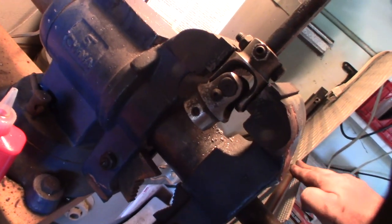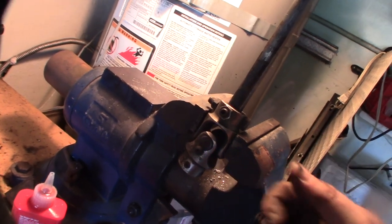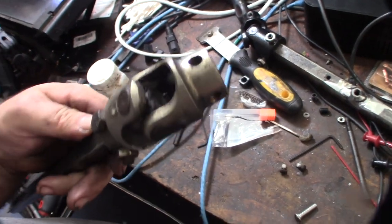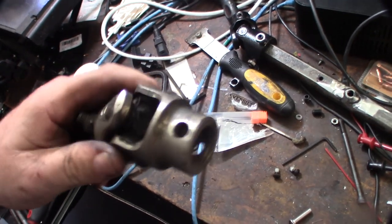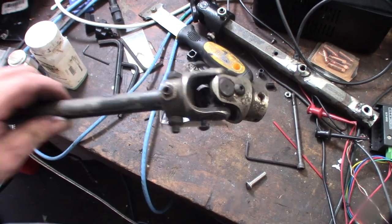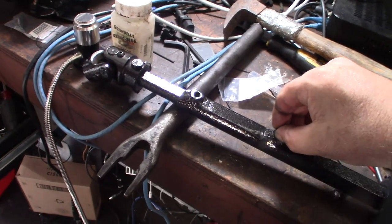Let me use my vice here and tighten it down — I don't want to over-tighten it. Normally you'd think you could just do it with the screw, but the screw isn't strong enough — it's just to kind of keep it in place and not actually push it in. All right, the slack is gone. The play is gone in here. The steering components are pretty critical, so you should use thread locker on everything, especially something that doesn't have a lock nut on it.